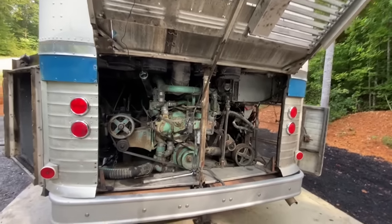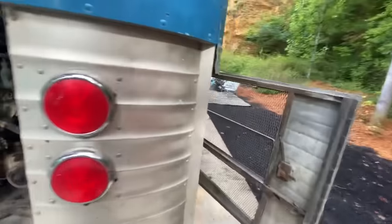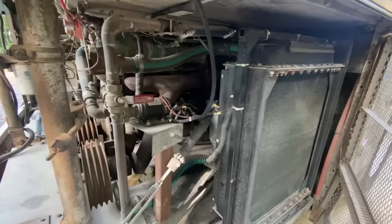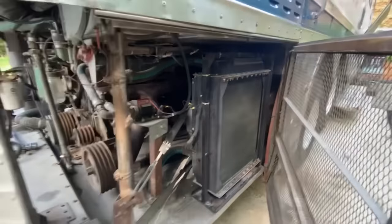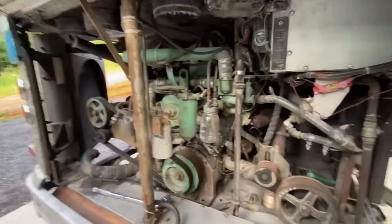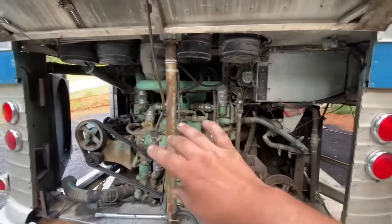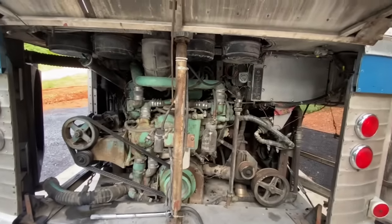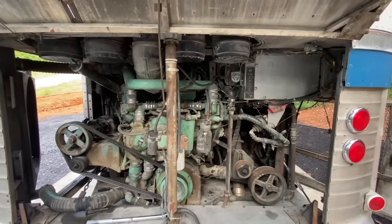Now there is an extra radiator that the previous owner had mounted on here. It's a beautiful radiator, but then he disconnected the electrical lines to the pump. It would just be a great thing to keep going all the time. You can't have too much cooling on these things. So that radiator is a great idea, and I recommend you hook it back up and use it. The thermostats will do the controlling that they need, so the cooler you keep the coolant that's fed to the engine, the further ahead you are in the game of cooling.